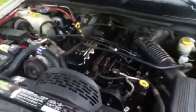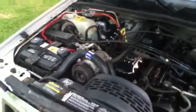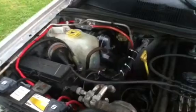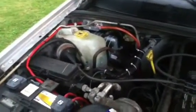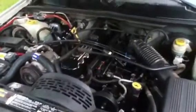I love it. And hopefully, if you guys are having any issues, these videos are helping you out. And like I said, just make sure all your ground connectors are clean. These things are really electrically touchy, but make sure your ECM back there has good connection to the plugs. Make sure the contacts are clean. Bend the pins up a little bit. Put some dielectric grease on it. Zip tie them, and then see how it goes from there. But if you still have an issue, then you probably have something else going on. So make sure you just test everything, like I did.